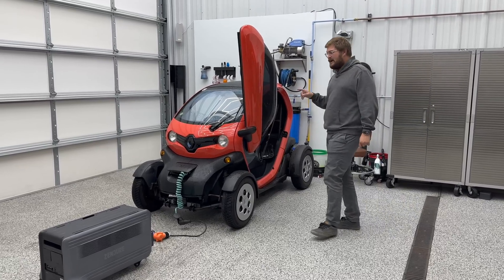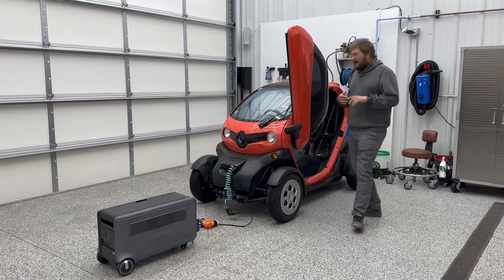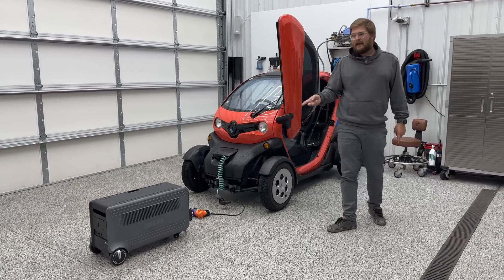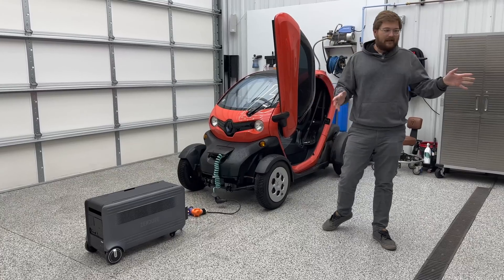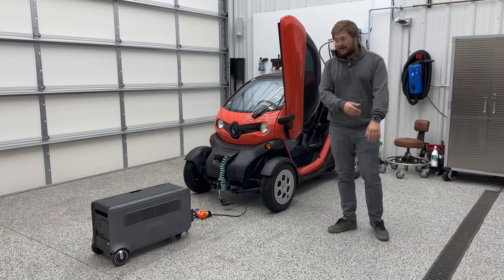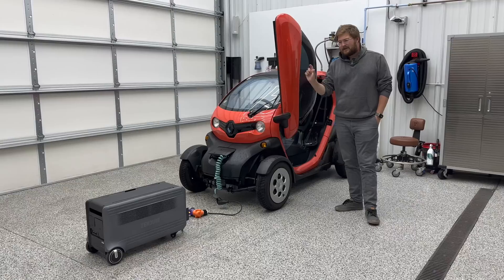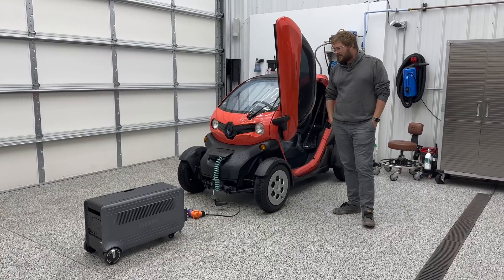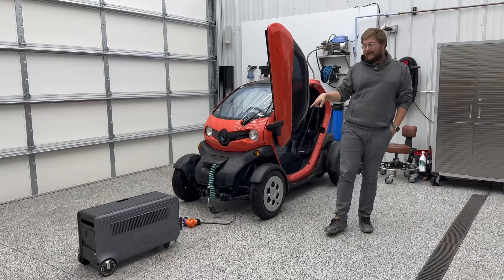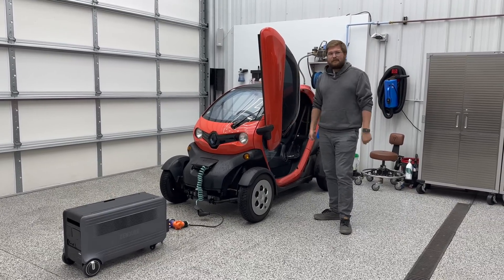In this case we're actually charging it on a 120-volt, 30-amp connection. However, we can go up to a 240-volt, 16-amp connection here — that's about 3.8 kilowatts. I plugged in a Tesla the other day and it ran flat out at four kilowatts, so the fans were running on this thing. I used a Tesla connector with a special plug to plug into their 240-volt adapter. Four kilowatts isn't bad to carry around in your trunk — I think that might be the most powerful unit that someone can just pick up.